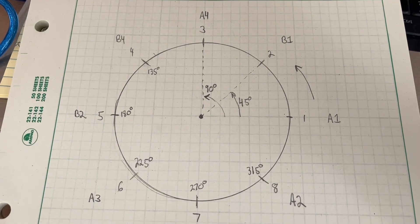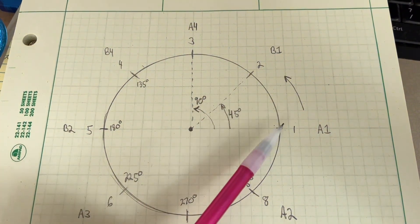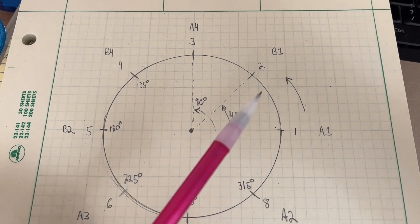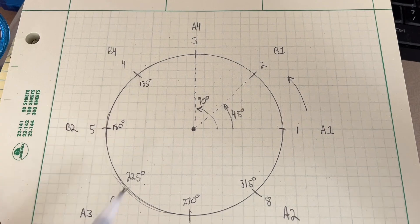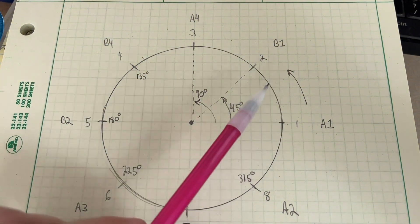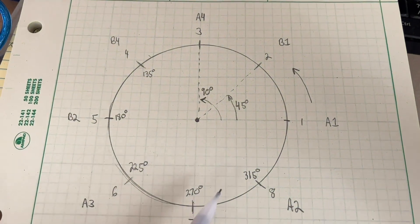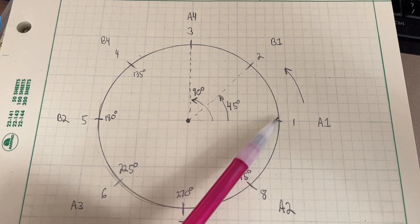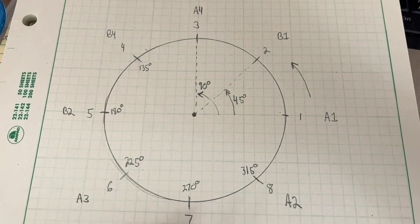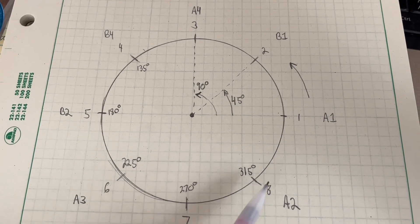The question is: are they really doing that or not? That's where we can use the Arduino to time how long it takes between firing cylinder one and firing cylinder two. If we know the RPM, then we know the time it takes for 360 degrees. We measure the time to that first pulse and we can find out how many degrees it is — so we can figure out whether the cylinders are being fired at the right times. We can also look at how long the points are closed, getting the dwell angle for each individual cylinder.